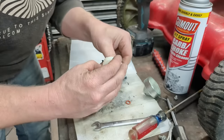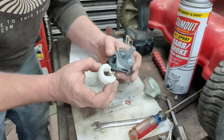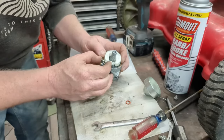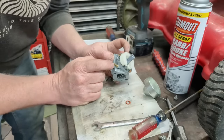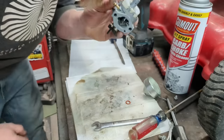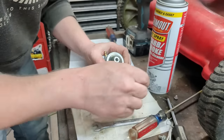Put the float back on. Now if your carburetor is leaking fuel or leaking out the throat of the carburetor, it's your needle in your seat not seating. This particular one it's just a rubber tip right on there. If it's super old you can replace this, or sometimes the acetone will soften up the rubber and make it seal again. If you want to know before you put it back together whether it's going to seal, use your mouth — put it on there, lift it up, blow, let go. If you hear even the slightest hiss, it's going to leak. This one wasn't — not worried about that. Clean out the bowl, bowl's clean, put that together.